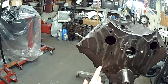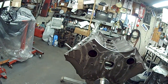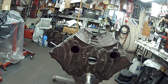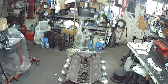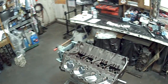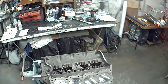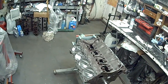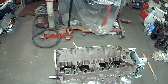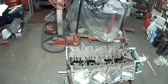As you can see, it's got the SR block there. There's nothing stamped right here - that is my stamp for the deck height, which is 10.224. This block had all the machining done. It was square decked, bored and honed with a torque plate. It has Icon forged 30cc dish pistons that I actually developed and had Icon make for me. Now it's an off-the-shelf part - they make them in all the different bore sizes. I used to get them custom made all the time and now it's an out-of-the-box part, which is great.